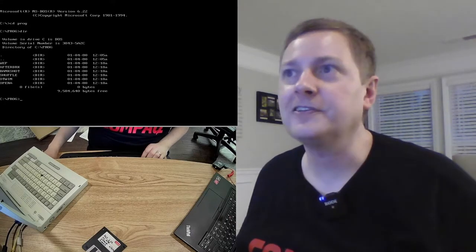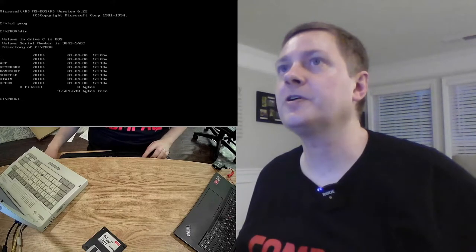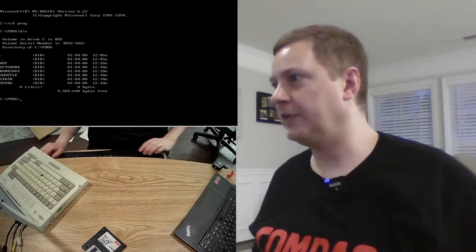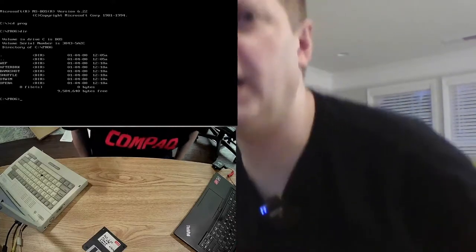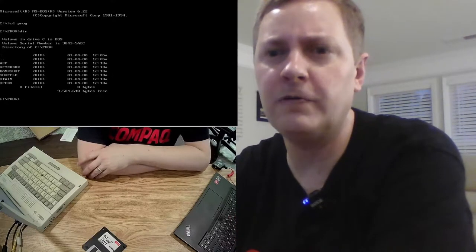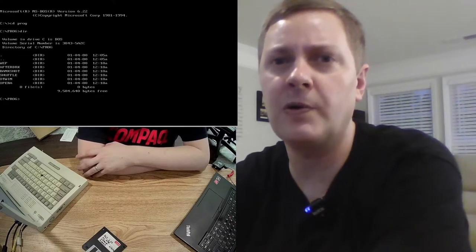As far as what sound driver to use for 98, funny you should ask. That's the video I'm working on today, and I just pushed the procedure. I'll drop it in the chat. If you go look at this procedure, it has a link to all the different drivers that you need, so you can check that out. It's VIA Vinyl, and it's available on Major Geeks. VIA Vinyl version 7.00 works well.